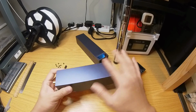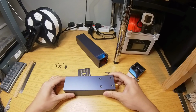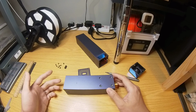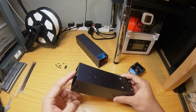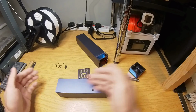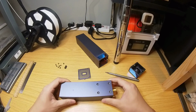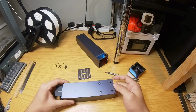This entire square sleeve basically is not holding the internals via anything else. There's no clip, nothing else once you remove the screws. So if you push gently from one end, either from this end where the USB socket is, or from this laser head end, you can push the internals out. Pay attention that if you push from the laser end, don't touch this lens. So I'm going to push from the heatsink end, just like that.